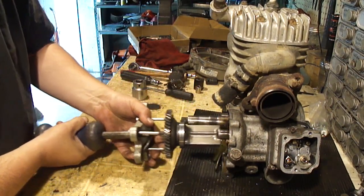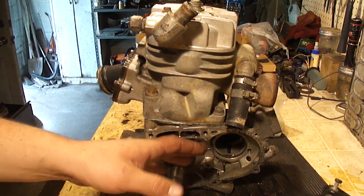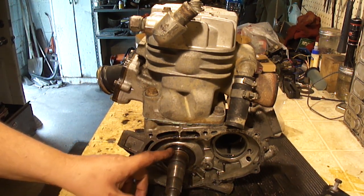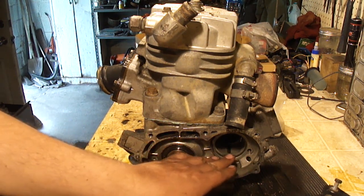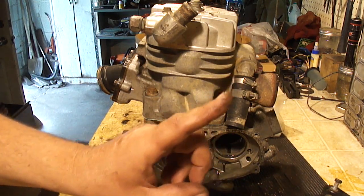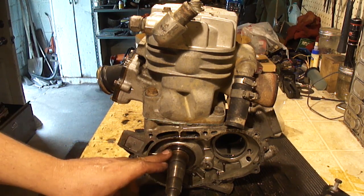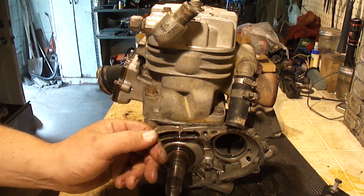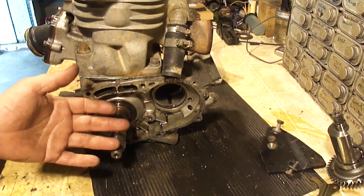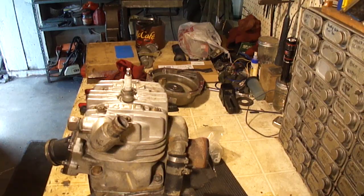There that guy comes out. Now there's a serious issue going on with this motor — I've been struggling with the engine sucking oil out of the balance shaft chamber and blowing it out the exhaust. In a previous video I replaced this seal because I was thinking the seal was bad, but actually it's something way more serious and I'll show you that when we get down to it. This was an issue I've been fighting with this quad ever since I got it.